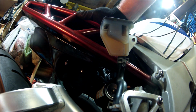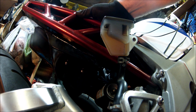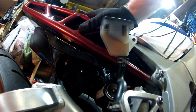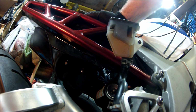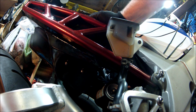Okay, so that was pretty much spot on. It's just over the length of the nut, which means that the nylock's got hold of the thread, so that's pinched on there. Nice, two more to do, and then trim that first one off, it's just a little bit too long, probably by about a thread and a half. So yeah, I'll get rid of those and then start plugging in the electrics.